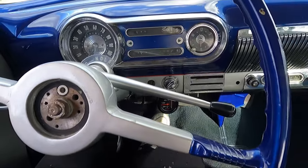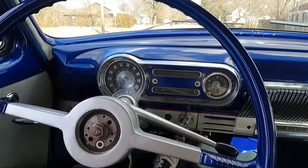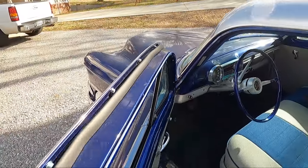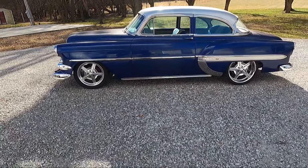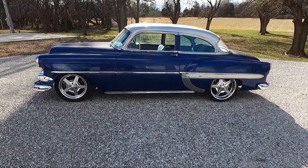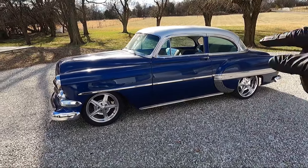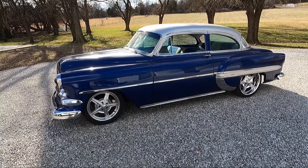I'm going to watch this temperature. It feels like it pulls a little bit to the right when I hit the brakes, but we didn't mess with the fronts — the fronts are what was on the Mustang II front end. I just got back. I drove this thing for probably 20 minutes, no overheating, no issues whatsoever. That is what I would call a win. We've got some creaks and whatnot, and none of the gauges work — other than that aftermarket temp gauge under the dash. But it steers good, seems to drive good. This is kind of how I do things: I start to loop out a little further and a little further. I've got some more stuff planned on this that I think we're going to start in this video, so I'm going to maybe put some street miles on it around town.